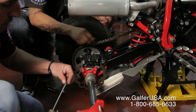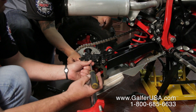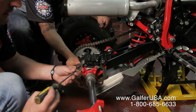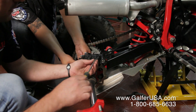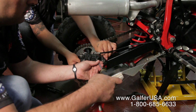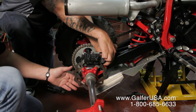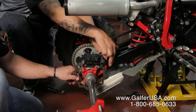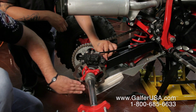How should we break in new brake pads? You want to ride the brake pads right at the beginning very easy — just light on the brakes. The pads need to sit into the new rotor surface and you have to make sure that you're not overheating them. Sometimes, if your rotor is pretty dirty, we suggest getting some 600 grit paper and cleaning the rotor. You just get 600 grit and spin it until you clean the surface up.